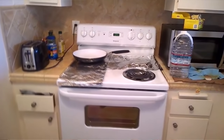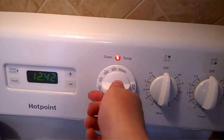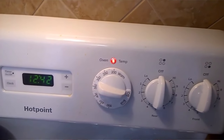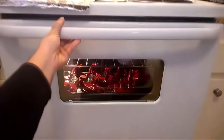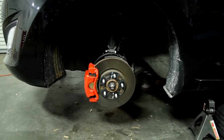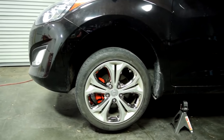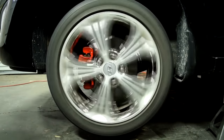We're not done yet — we need to bake and cure the paint on these calipers before we can install them back on the car. First, wait three hours, then preheat your oven to 200 degrees Fahrenheit. Get a cooking sheet, put the caliper and the brackets on there, put it in the oven, and set it for one hour. Once they cool down, you're home free — grab them, install them back on the car, and enjoy your new shiny calipers.